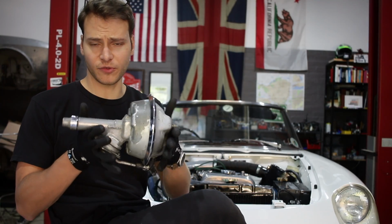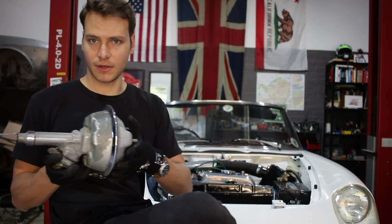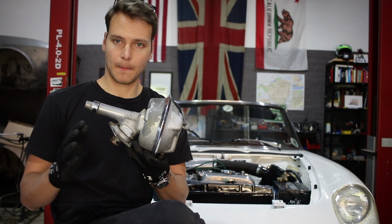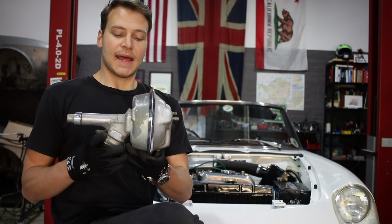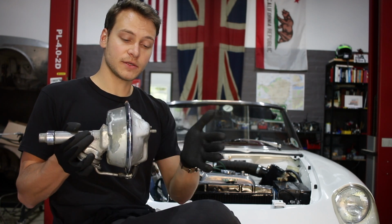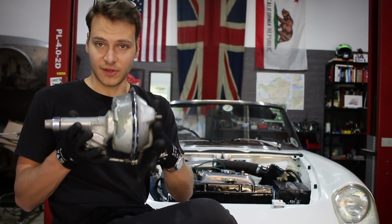This is a part of most classic cars that people find quite intimidating, because there's a sort of dark art about this kind of stuff where no one really knows how it works. But I thought I'd explain it as simply as I could. It's actually very easy. This brake booster runs off engine vacuum, and the vacuum, as you're driving along, is held in this chamber here. As you're going along, this chamber is filled with vacuum on both sides, and there's a rubber diaphragm in the middle with a plunger on the end. When you hit the brakes, there's a little low pressure circuit inside here that operates this little valve on the bottom. All this valve does is expose the rear side of this chamber to atmospheric pressure. Of course, you have vacuum in the front, atmospheric pressure at the back, and it will push the plunger along and actuate the pistons inside here. It's actually very easy once you understand that.